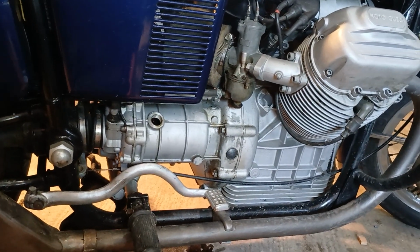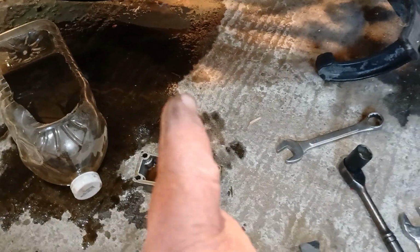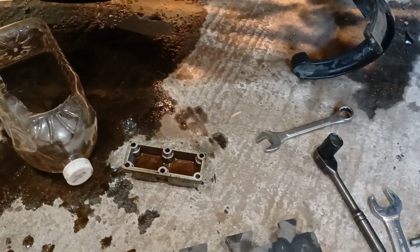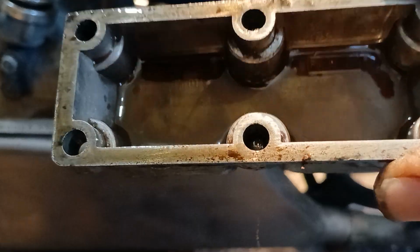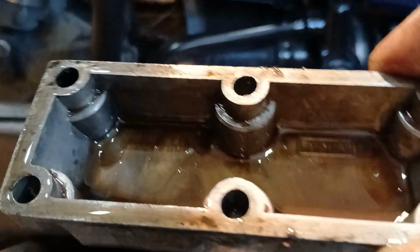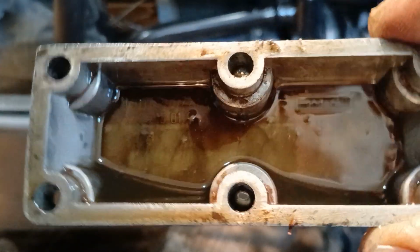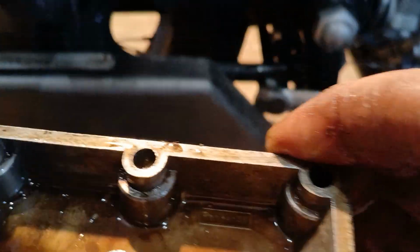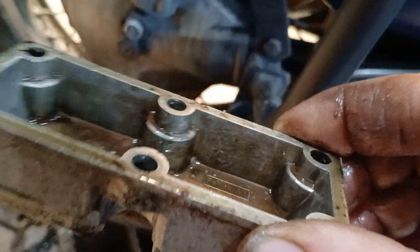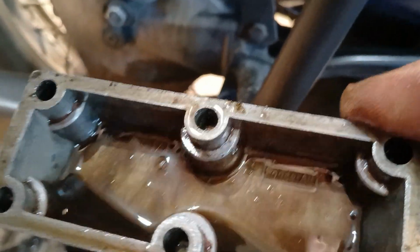ZDDP levels at about 1400, so it's quite high. It's an old-fashioned oil, basically. So that thing there causes me an enormous amount of grief, and I just cannot see the point of it anymore. I imagine in the old days, when they wanted you to stick molybdenum additive in the rear end, this would be where the molybdenum collected, because it tends to fall out of solution, and then when the gearbox gets hot, it goes back into solution. I don't think that's really necessary with modern synthetics.